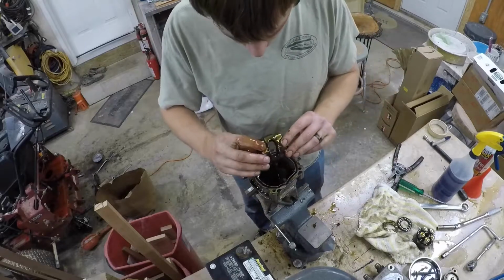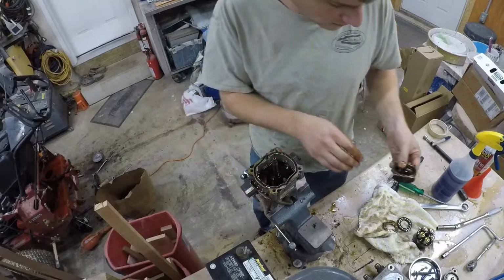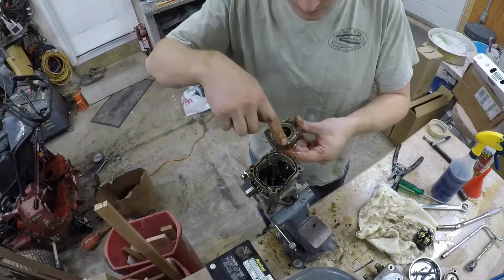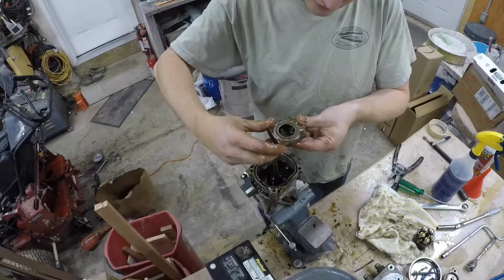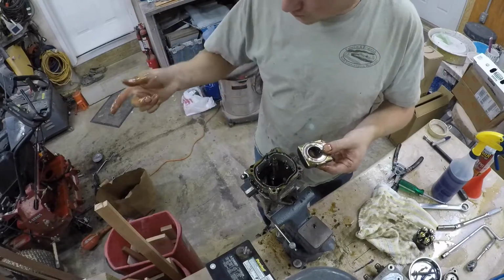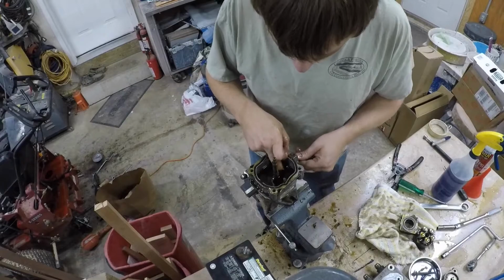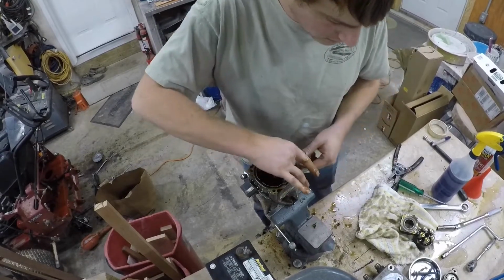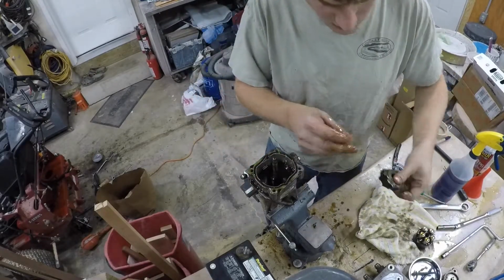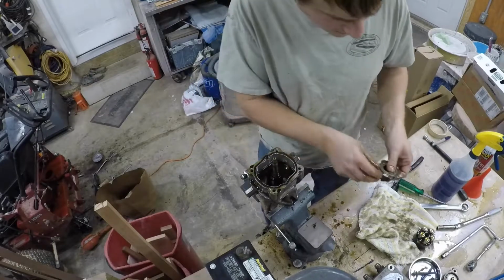There's the swash plate at the bottom of the bearing. So this is all under oil. The way that sits in there like that, then that piston barrel rolls around on that. So when this moves back and forth, it pushes one side or the other of those pistons and tells the pump which way to pump the oil out of it. So it's pretty neat. I don't really know the right way to explain all this stuff, but it's pretty neat. And there's a little tiny square piece of metal that goes in this swash plate right like that, so it helps that move up and down while that pin's in there.